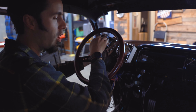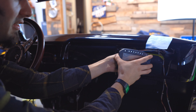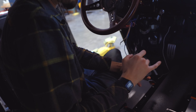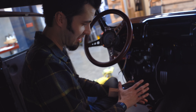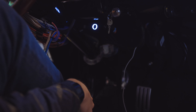On the interior — we're waiting on a mount to be designed for our AEM Dash 2. The customer wanted analog gauges, and having a digital dash on an old car like this would take you out of it, so we put the AEM dash in the glove compartment. It'll let you look at every single battery cell temperature, voltage, current — all the information you could possibly want. This talks to the AEM system and the T2C. For making the thing run we have our neutral, reverse, and drive switches. The brake switch is mounted on a 3D-printed bracket to the brake pedal — it won't select drive or reverse until you hit the brakes.